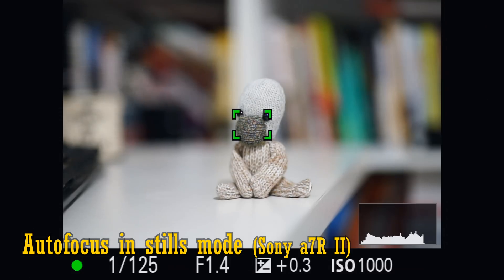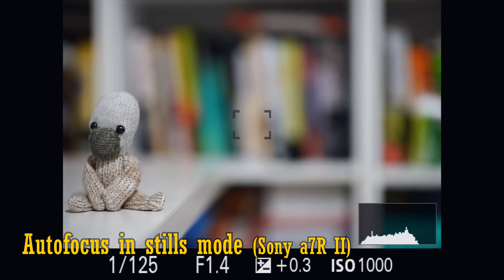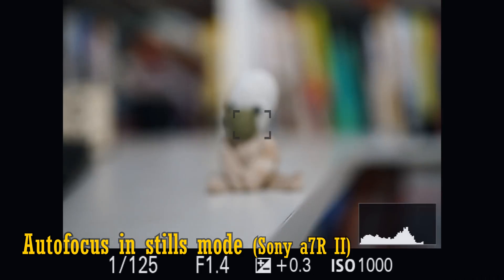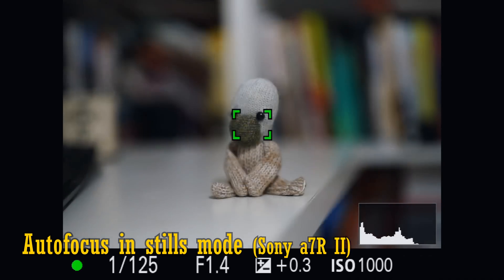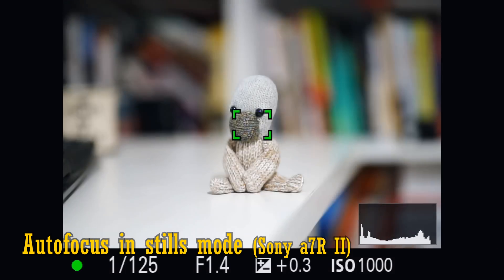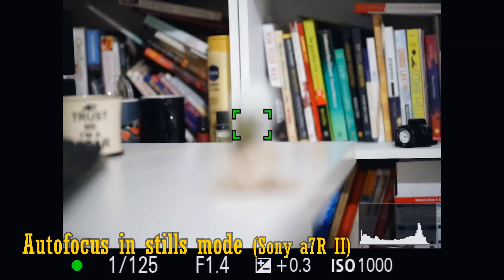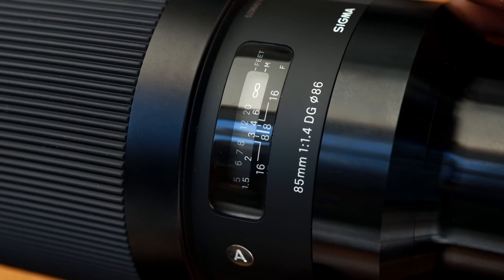In use, the autofocus system was fast enough, but not as snappy as with other lenses designed for mirrorless cameras. It has to do a very brief micro-adjustment before really landing focus, but you must take into account the hefty glass elements it's moving around, and that mirrorless cameras tend to be happier to work with efficient stepping motor lenses rather than the more common ultrasonic ones you tend to see on digital SLR lenses — although this performance is still perfectly fine really. As the motor turns, it emits a quiet whooshing sound.